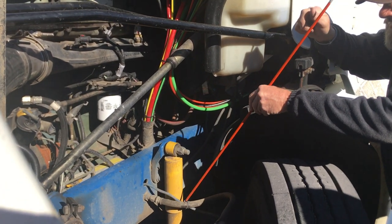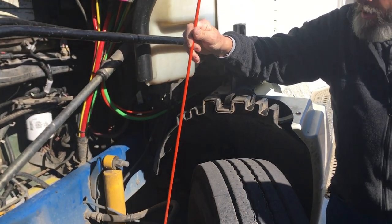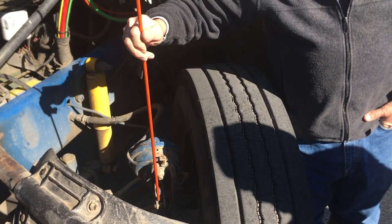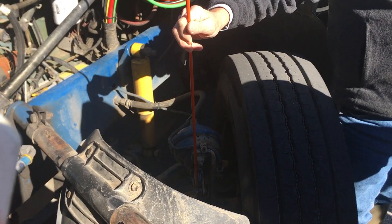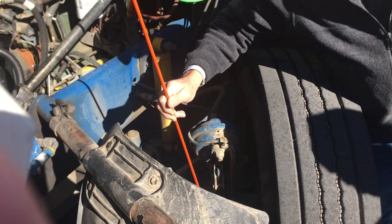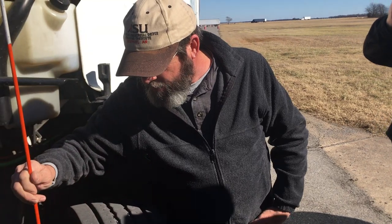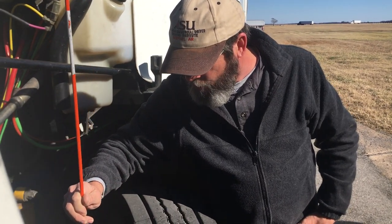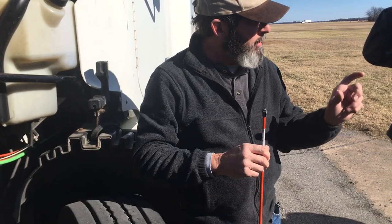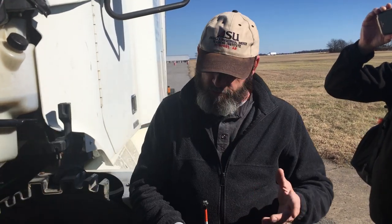Now I'm going to start on my air brake system. Air line coming from the inside out — no dry rot, no cuts on the hose. If I had air supplied, make sure no air is leaking out. My brake chamber is here — not cracked or broke, the band holding it together is tight and secure, and it is securely mounted. What comes out of there is my push rod — not cracked or broke, securely mounted to my slack adjuster. It kind of looks like an upside-down ice cream cone. It is not cracked or broke; they are held together with a pin and a cotter key. If I had air supplied the system, it should not move more than one inch by pulling it by hand. That's how DOT knows if your brakes are out of adjustment — they crawl under there, have you release the brakes, get a little ruler. If they can pull it more than that, you're out of service and you get a ticket.